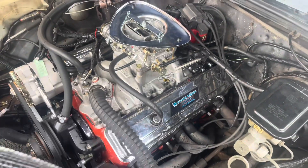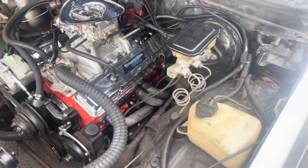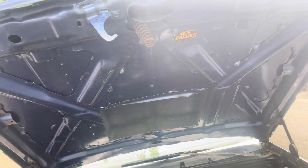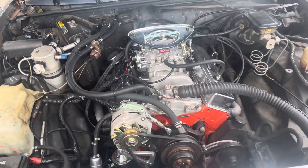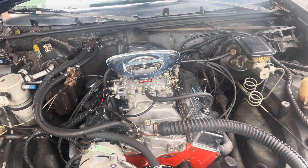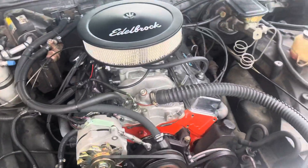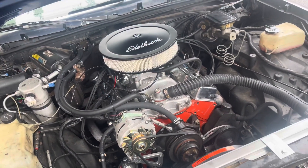This thing's gotta go. The shop couldn't put a bigger air cleaner on because my hood wasn't clearing with the 14-inch, but I've got a scooped hood now so we should be good. Let's get the air cleaner on here — the 14-inch Edelbrock recommended by the carb manufacturer — not this sponge crap. I couldn't fit the air cleaner I wanted until I got the right hood.